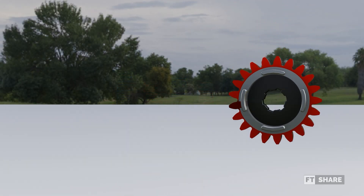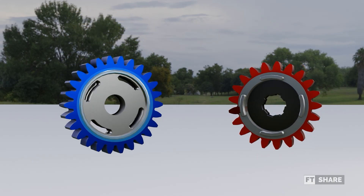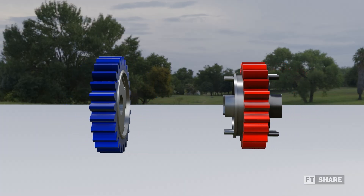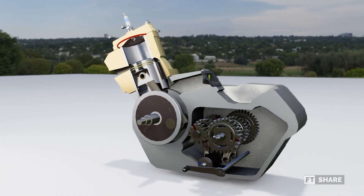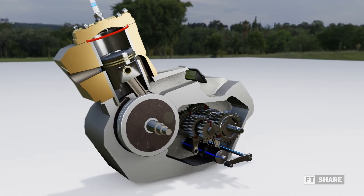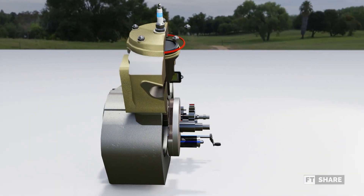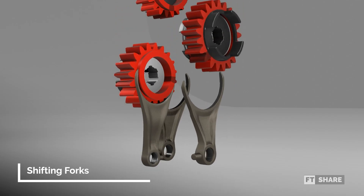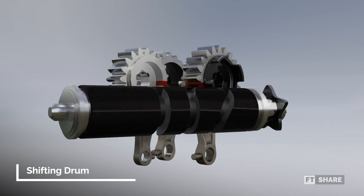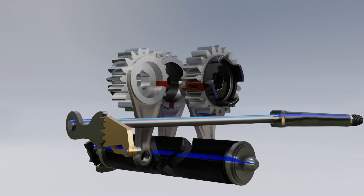If we look in detail, on the side of the slide gear there are teeth called dog teeth. The freewheeling gear also has gaps slightly larger than the dog teeth, which allow the dog teeth to engage and lock the two gears, connecting the slide gear and the freewheeling gear. When one of these gears is rotating, this type of gear system allows for shifting without pressing the clutch lever. However, unlike the quick shifter, shifting gears under these conditions without using the clutch will result in rougher gear changes. Next we have the shifting forks, which act as levers to engage specific gears. Below that, we find the shifting drum, which has grooves for each shifting fork to control the gear ratios. Lastly, we have the gear shift lever, which operates the shifting drum.